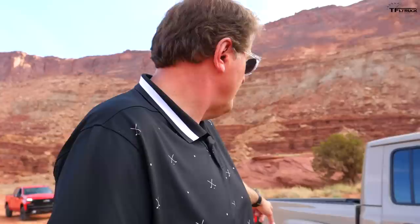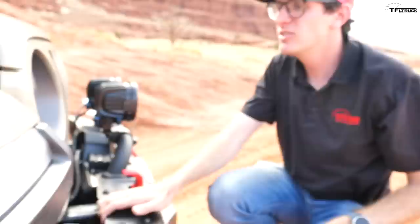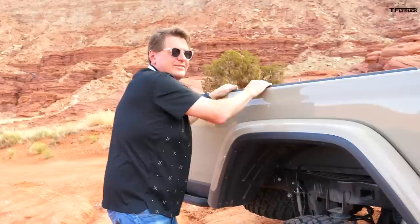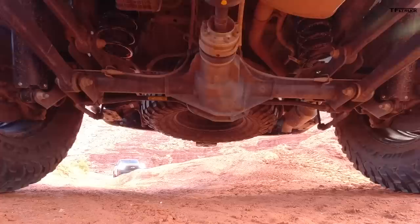The tire has actually cleared the fender, while the rear passenger wheel is completely off the ground. Only two wheels have traction — in the past this kind of articulation is where vehicles get stuck. Luckily, the Gladiator out of the box is one of the most capable off-roaders you can buy: you can lock both the front and rear diff so that even if one wheel is in the air the other wheel always gets power, making it incredibly capable.